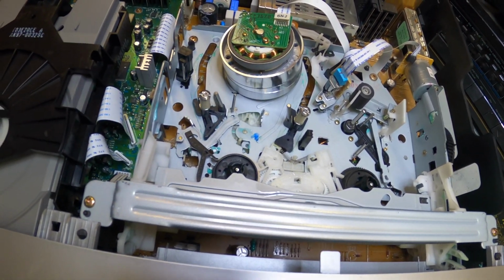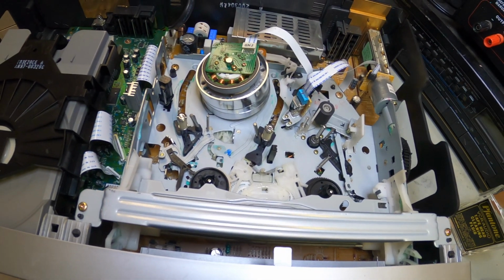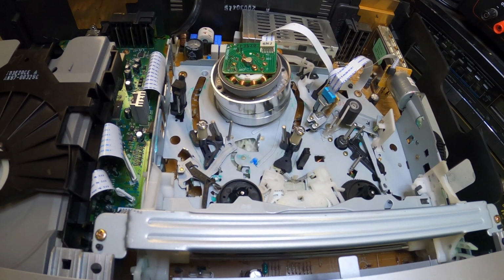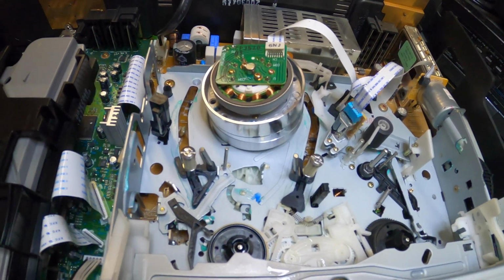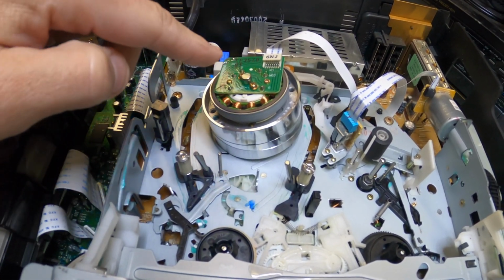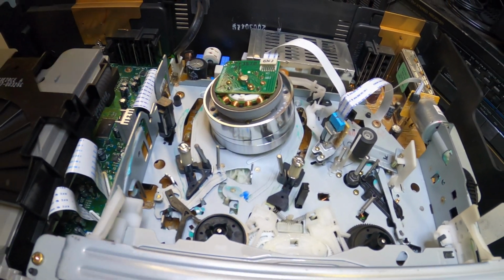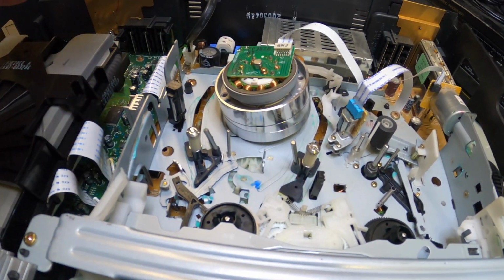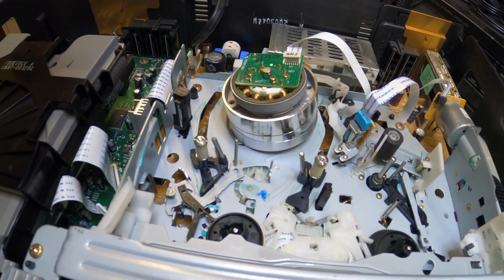Very, very easy. You guys have any questions or any comments? I get comments all the time about cleaning VCR heads. And this model here, I have a couple of videos on my channel, and the models are pretty much the same. Sometimes they have contacts on top for tracking contacts. Clean those contacts. So anytime you see a contact, the head, anything that reads, always clean those the way I showed you.